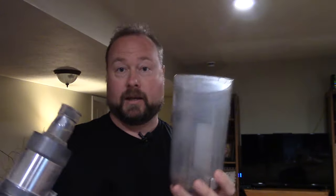Set it up one way and then come back overnight or in the morning, flip it on its side, and make sure everything is completely dry before you put it back together. This filter has a little groove and notch — fit that right where the button is and you've got it. There's still one more filter: the exhaust filter. It's kind of hidden in here, and this is what gives the Samsung its HEPA rating. Take it and give it a quarter turn counterclockwise — lefty-loosey — and it pops off, revealing the paper pleated filter inside.